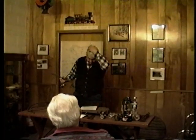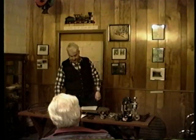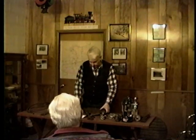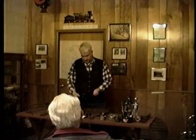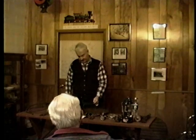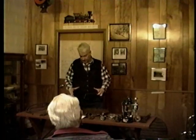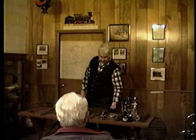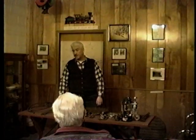In the earliest cars with the cast iron grate had what they call a single burner. This is a double burner grate. It has the two large holes in the front here. The earliest cars only had one. And this is, I guess, the single tube vaporizer. And they were on the smaller burners and the smaller boilers, usually on the tiller steer cars, I think up to about 1905. And then when they came out with a 10 horsepower, they changed it to 10, yeah, I guess 10 horsepower. The first coffin nose cars were 10 horsepower, isn't that so?